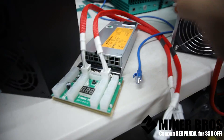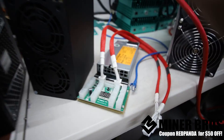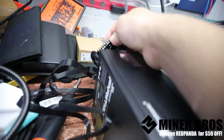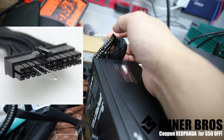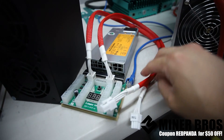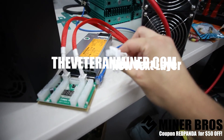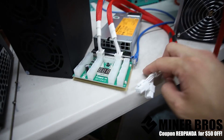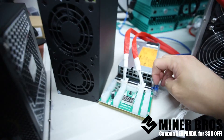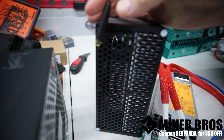There are two different power supply methods we could use. I have an HP server PSU with a breakout board and PCIe cables from TheVeteranMiner.com — I prefer this way myself. But an alternative is a typical ATX power supply with two PCIe cables, and you'll have to jump the 24 pin to turn on the ATX PSU. You are also going to need an Ethernet cable to initially set it up, but this unit does have Wi-Fi as well.